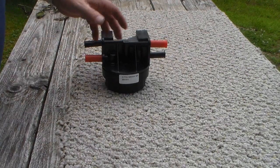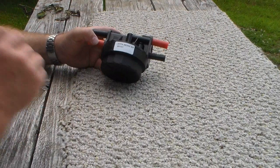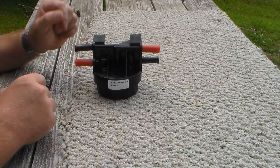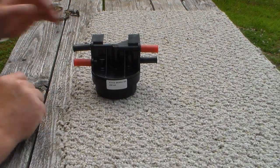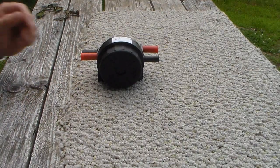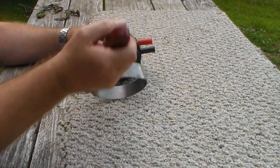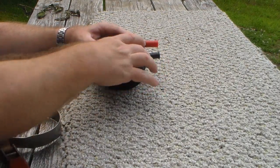Okay, here we have a genuine article. This is a fuel reservoir for a single tank truck, which I ordered. They sent me the wrong one, and so that was how I wound up with this one. So anyway, in order to get this bowl off, you can use an oil filter wrench such as this, and just slide it on. You'll need a bigger one than this one probably, because you'll want to grab onto it right around this base. That's the best surface.